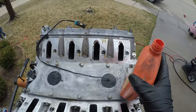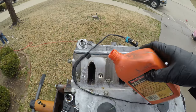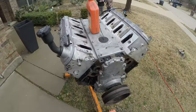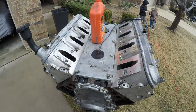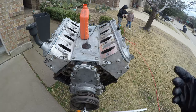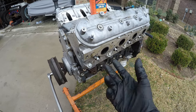I'm going to take some oil and pour it down the cylinders — just a good amount, maybe a capful, maybe a little bit more. Then I'm going to rotate the crank a few times so it will mix that oil into all the cylinders. So if there is any water in there, hopefully it will mix with it and prevent the cylinder walls from rusting if any water got inside the engine — which I'm sure some did. I'll do this a few times and let the engine lean one way or the other to help get some of that oil back out. I also want to pull out the spark plugs and shoot oil in the actual spark plug hole to coat the whole cylinder wall as well. But this is kind of step one.